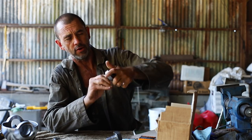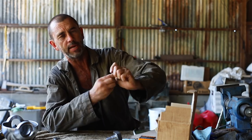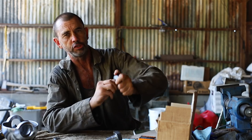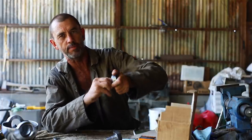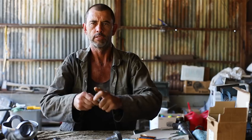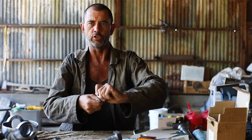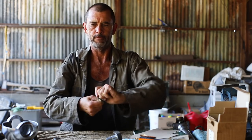And so we're going to start eroding away the inner diameter of this bush. Now, initially I had the idea that I'd wrap sandpaper around a socket, but the socket was too smooth and you couldn't quite get the control you can with your good old finger. So this is the scrub and rotate method. We're going to make it fit. Oh, look, the nose of it's going in. So there is serious potential one may die of old age while they're undertaking this lengthy process. However, if it works, that's what we need.